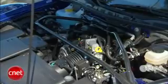Now this engine, by the way, is called the Renesis. The Renesis generation has a reworking of the intake and exhaust ports. You see, there are no valves on a rotary engine, just big old holes. And as the rotor goes around, it covers and uncovers them, basically. And what they've done here is re-engineered it so that at no point is the exhaust port open while the intake is open.